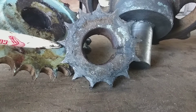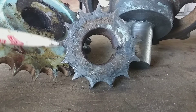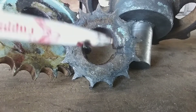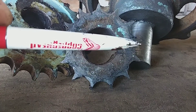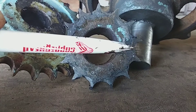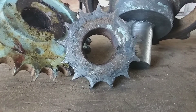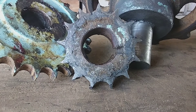All my bearings are already starting to wear out. You can see how bad this one was — it was only riding on the chain here and leaving a deposit there. You can tell the tops of all these teeth have gone. You can see real bad over there how that sharp curl comes up with original material, and then it was supposed to come back out, but it has worked all that material down. I think that's what's causing our chain pop, plus not having the sprocket secure enough under high tension and stress.